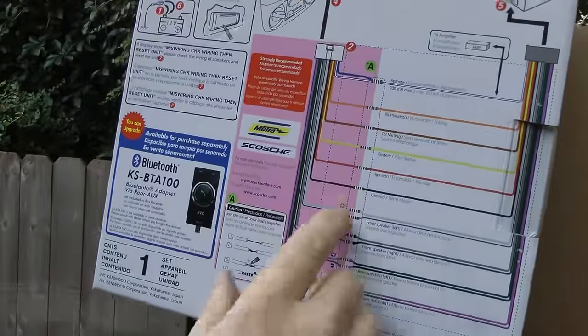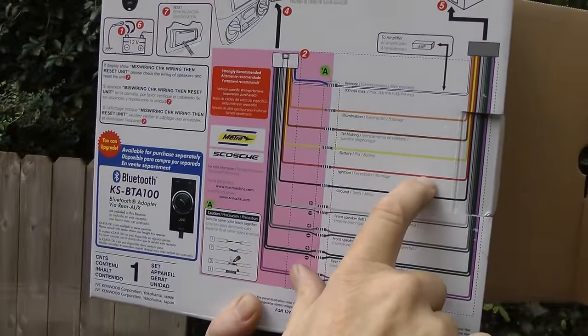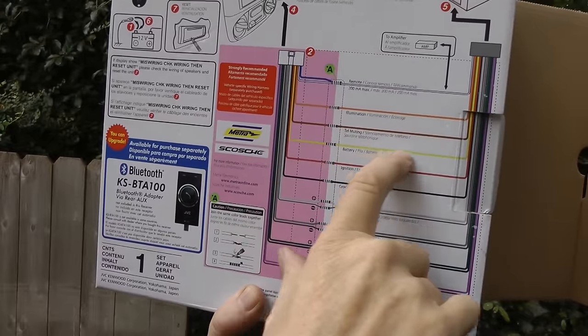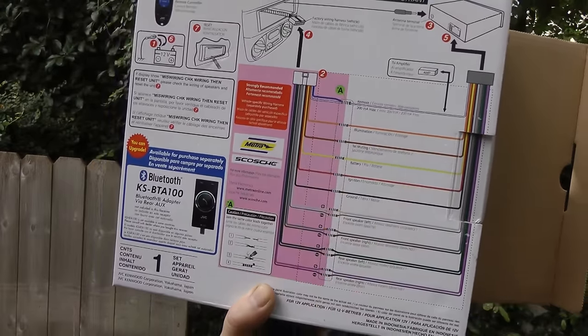But if you're not lucky, they come with directions. The red wire is the ignition — when you turn the key on, it sends power to the radio. The yellow wire is the battery wire that goes direct from the battery and has power all the time to keep memory in the radio. It's not that complicated, but in the case of a car like this that has four speakers, there's not an eight-speaker wire, so it takes a little bit of time.